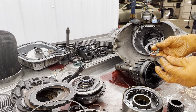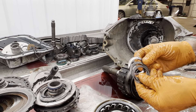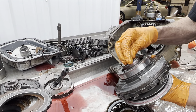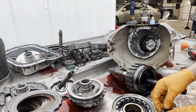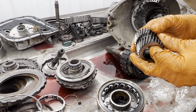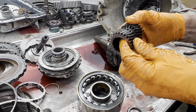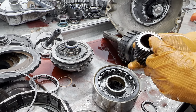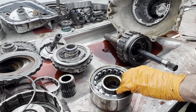We have a roller bearing here — chamfer sits down in here, this sits on top. Sun gear you want to look at really good, see if there's any pits, see if it's been hot. Hot looks like it — purple, especially on that one side. I have a new one over there — we always replace them 90% of the time anyway.